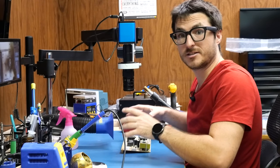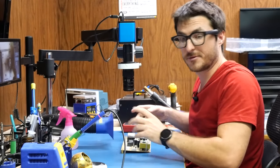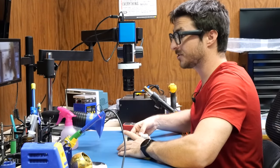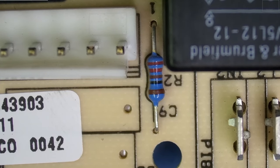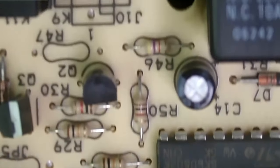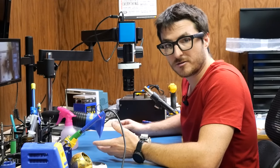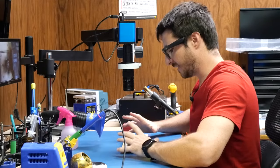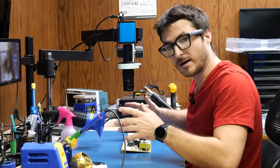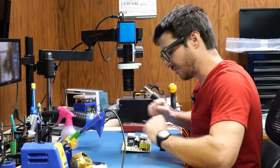Because this is a double oven controller board, the circuit board is the same on the top and the bottom — it's kind of a mirror image. The resistor that was supposed to be there is essentially this one over here. This is a 221 ohm resistor. We're going to be installing a new one, but we also have to tackle the issue that caused this in the first place. The customer stated there were no other problems, but looking at the board, I did find a couple things.